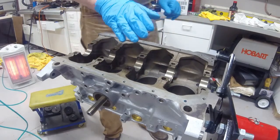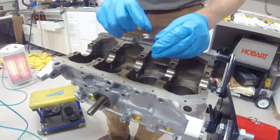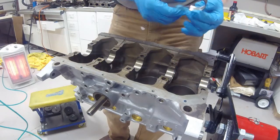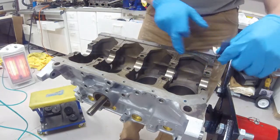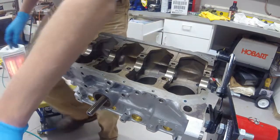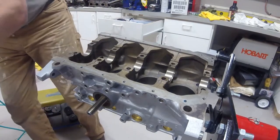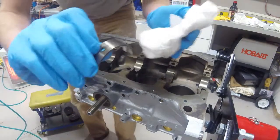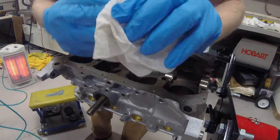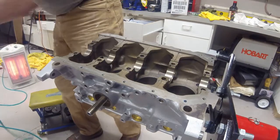The next step is to install your main bearings. This is a main bearing — the block side of the bearing. You'll see a port for an oil gallery which will coincide with the port in the block. There's also a little tab that locks in — there's only one direction these can go in, and these can only go on one side of the crankshaft. The other side of the bearing does not have that hole. I'm going to take lacquer thinner and wipe the bearing off one last time to ensure there are no residues, oils, or dirt on it. Once it looks very clean, I will quickly blow it off with the compressor.